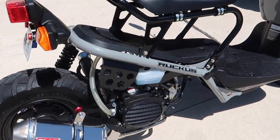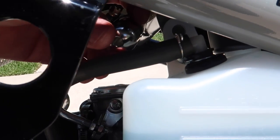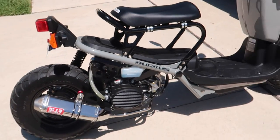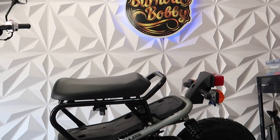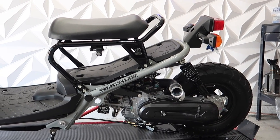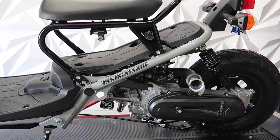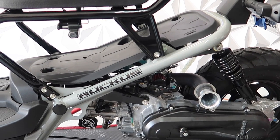That's the bike completed — sounds good, running good. You can hear a little gurgling noise — that's the decompression tube. If I put my finger over the exit of it you'll notice it goes away, so that's just the compression coming out and the hose is just breathing. It's running good — about to give it back to the dealer. I hope this video was helpful for installing the 9.5 stretch. If you have any questions, feel free to message me on YouTube or Instagram. I have a new build series coming up for myself, and a couple other builds coming in — one from New York, another one from Florida doing a stage 2 kit. I appreciate you guys and all your support — be sure to like, share, and subscribe.